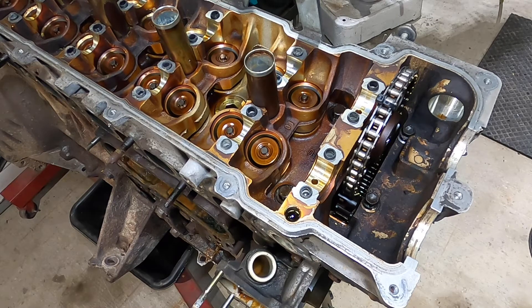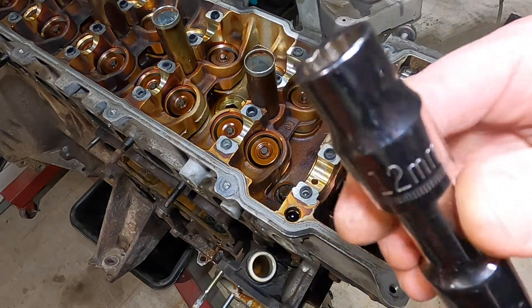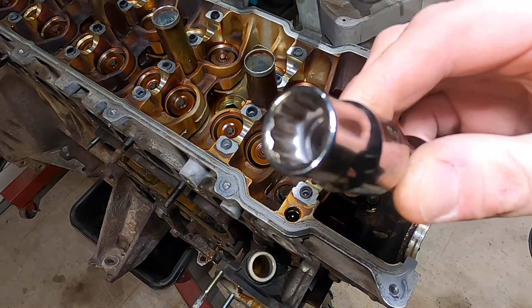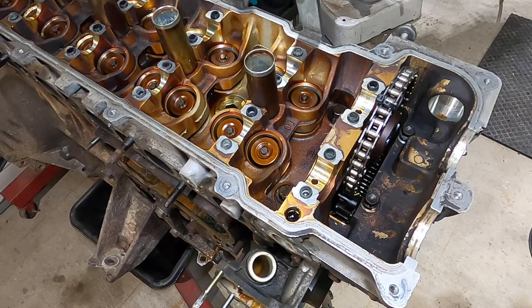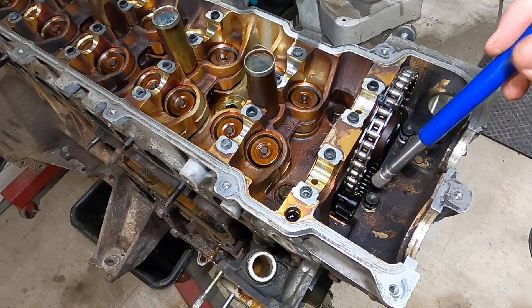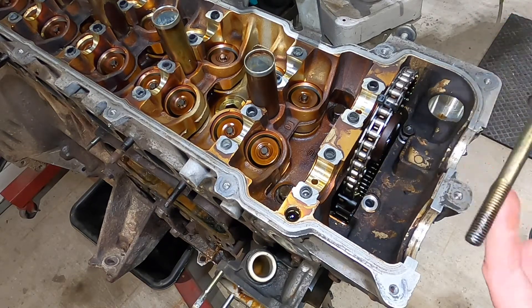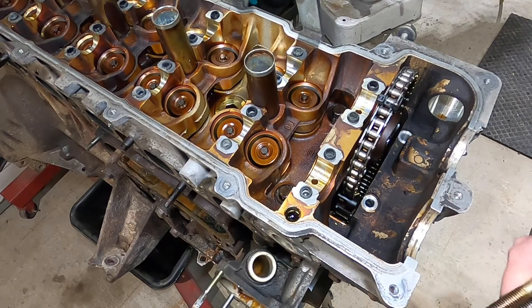So we're back and I've got the correct tool for removing the cylinder head — it turns out it's just a 12 millimeter 12-point. I just happened to not have it the other night. I'll remove these two bolts down here. I've already loosened them up, I'm just going to pull them out — they're a bit longer than others. We just want to remember to get those before we start loosening up the cylinder head.